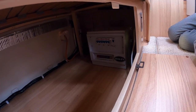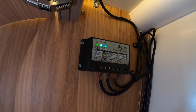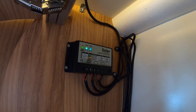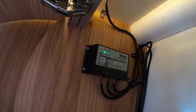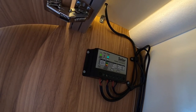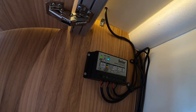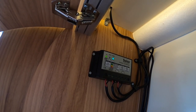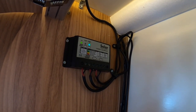In the overhead locker behind the driver's seat is your solar panel charge controller regulator — it's charging two batteries, your engine battery and your leisure battery. When the green light is flashing the batteries are full; steady green means normal; steady yellow means batteries are low; and steady red means they're nearly empty and you may need to hook the vehicle up. Currently it's showing full as the vehicle has had sufficient charge.